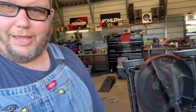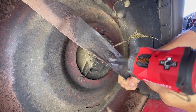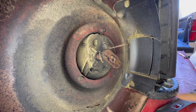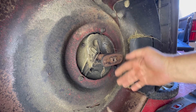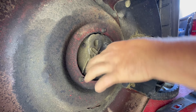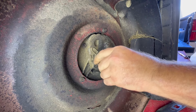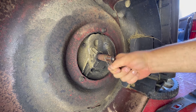If he hits another stump and it disintegrates, that's operator error. Let's get this thing torn down and get it on the straightener and see if we can get it within a thou or two. Let's go ahead and zip the blade off - it's just a 5/8, same size as the spark plug. A lot of times it will knock the tits off of the blade adapter, but this blade adapter doesn't seem to be broken. A lot of times it'll just crack right there where the keyway is. This mower being new enough, it should just slip right off - there we go. Got a bunch of junk around the crank there.